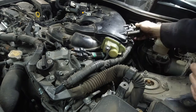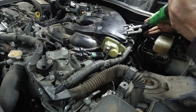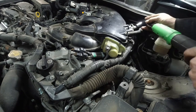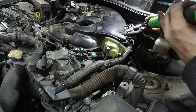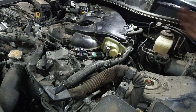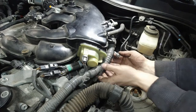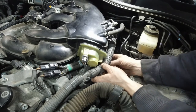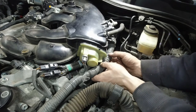Now that fuel line - I could not find any torque specs so I'm going to do 15 and see where it takes me. Maybe a little bit more - about 18. If it's going to leak, just tighten it up a little more, probably even goes up to 20. One more bolt - another 12mm for that bracket I was telling you about, right behind this harness. Now that I look at it, you would not be able to do the last spark plug with the intake on.